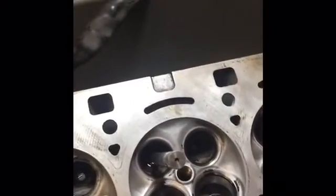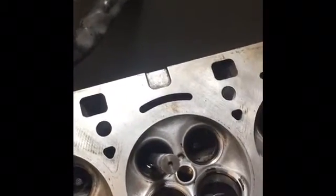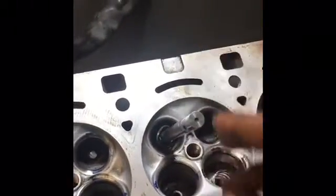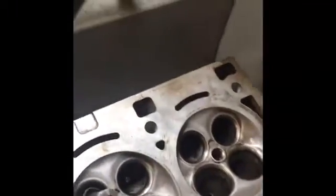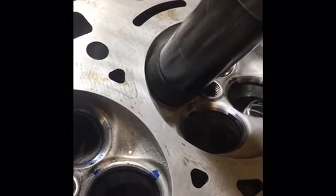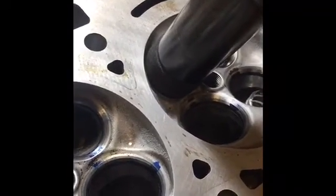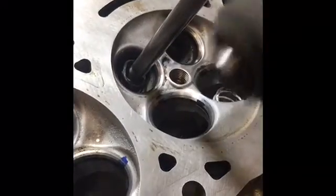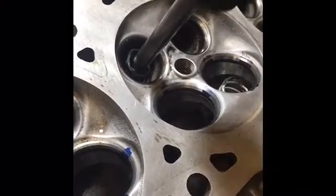From there, we want to pick a spring, and this just alleviates our grinding stone from always being in contact with the surface. I'll try to get a good video of this. As you can see, there's a little bit of give. Well, that give is keeping this grinding stone up and off the surface of that seat.